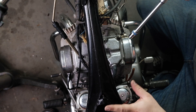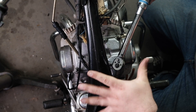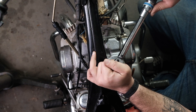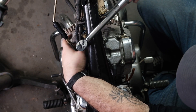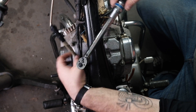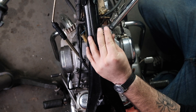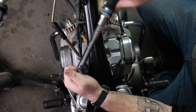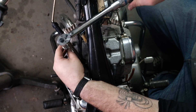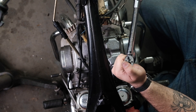Not quite done yet. I'm going to go back around one more time to make sure there isn't a little bit of slack left from the bolts. Sometimes as you do the torque, the part flexes and changes just a bit. One — just a hair more it went, not too much, that's usually the case. Two... three — nothing. Four... five... six... seven... eight. That's it.